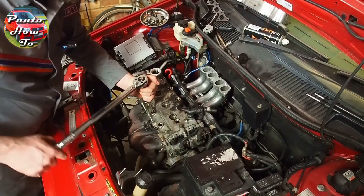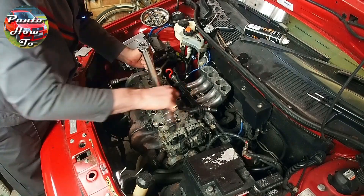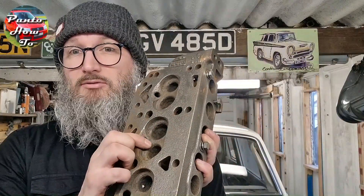Going back to Jim for a little bit more advice on things we can do whilst the engine is in bits: doing a similar flatness check on the inlet and exhaust face is very useful, and you can do the same on the inlet manifold and exhaust manifold — because what you don't want is an air leak that could have been easily solved whilst everything was apart. Also check for any cracks between the valves on aluminium cylinder heads, which is a common issue. Depending on mileage, also look at the valve stem seals, since it's an easy job to replace whilst everything is apart rather than having to take the cylinder head off two or three times.